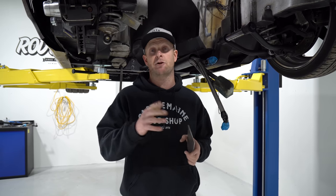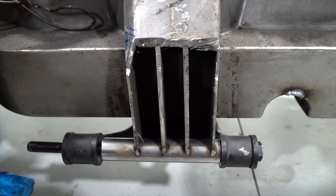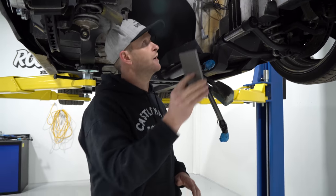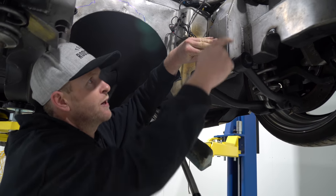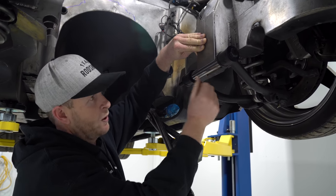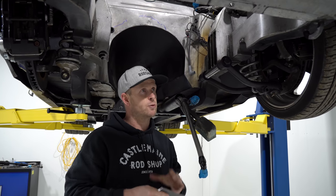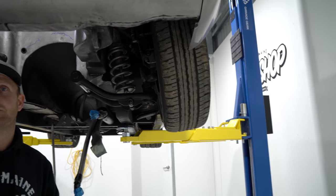We're back - I did come in on the weekend and made a couple of adjustments and got this lower arm pin in position. It's only tacked in because as an apprentice I was always taught to tack first as it's very simple to take out. I also cut a plate which is going to sit across here to give it some structure - once it's all welded up we'll run a nice TIG weld across here and underneath as well. I got the lower arm mounted but, like we knew would happen, if you bring the camera in and look front-on at that wheel it looks a bit like Tokyo Drift - so we're going to have to shorten that lower control arm up.